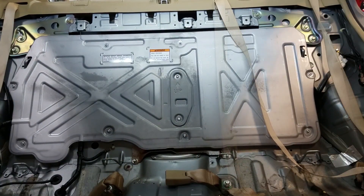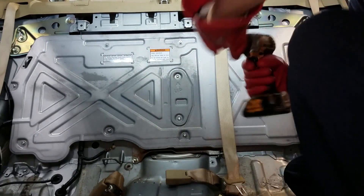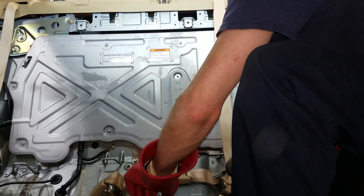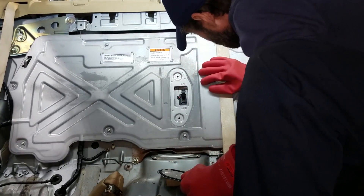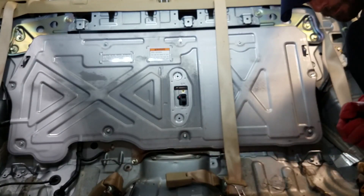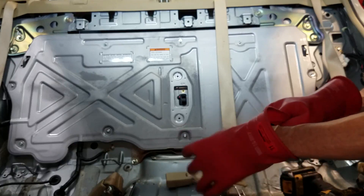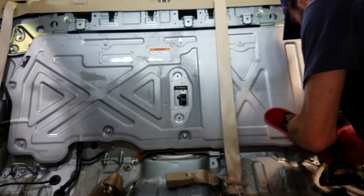Now that we've got this rear seat cover off, first I'm going to wear my protective gloves — I'll leave a link below where you can find these on Amazon. First thing we're going to do is disconnect the accessory battery under the hood, and then we're going to remove this panel so we can shut off power from the high voltage hybrid battery so we can work on this thing safely. We're still going to want to use our gloves here — in theory all the power should be shut off, but we don't want to risk anything, so safety first.